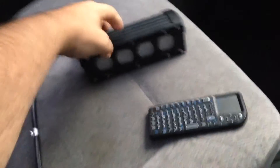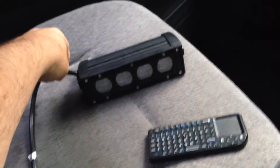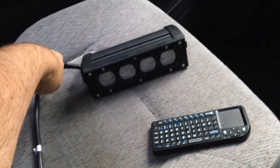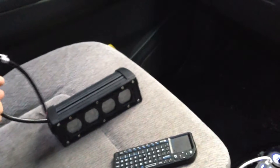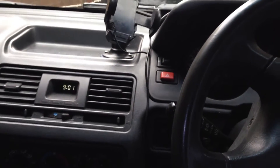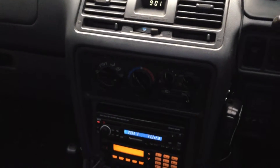There's the really high-intensity spotlight for the bull bar, when that arrives. We have to be careful — we need a bull bar that works with airbags, otherwise you set your airbags off with the slightest bump on the bull bar, and that's not wise. We've also got to fit another digital UHF radio in here.